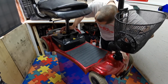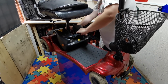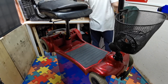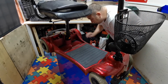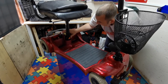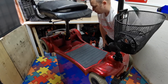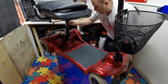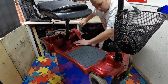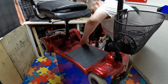And I know the battery tray lifts out just like that, and that's the batteries disconnected there, so that's a nice and easy little removal there. So we've got a bolt there. I might take that out because that will just clear the seat off then, and that gives us a bit of better access. So I'll take this bolt out. I'll take this back grab handle off as well, which is 4 screws, and then we'll have a look to see how this base comes off.